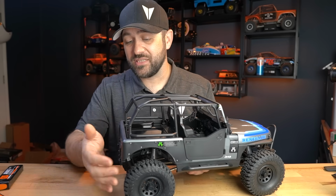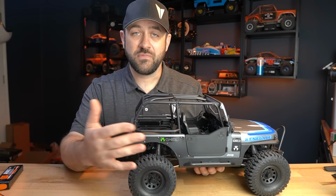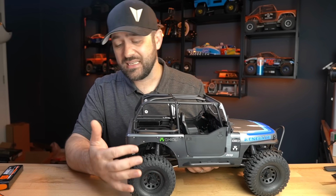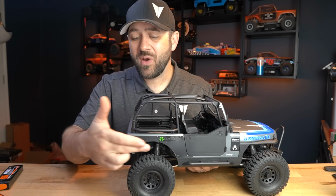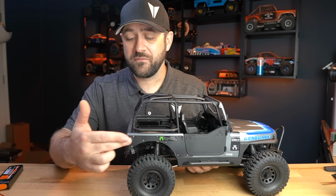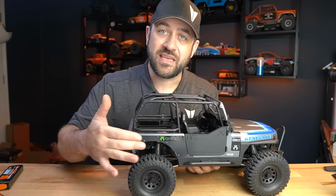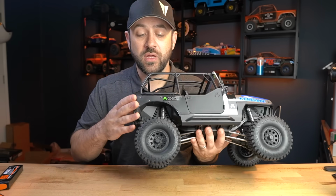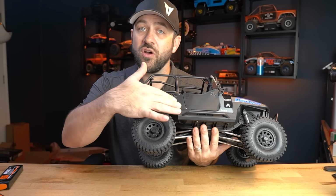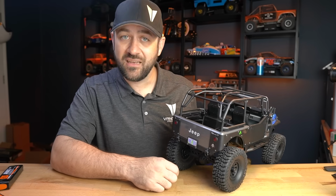On the back of this Jeep, they've increased the wheel arches in general to make it appropriate for a nice large size tire. Opened it back up. It's not quite comp cut, a term which means they cut the fender well straight back from the top of the wheel opening, but it does have the armor that's mounted to the body. So it goes all the way up to that door frame, around the corner, and captures the taillights in there.